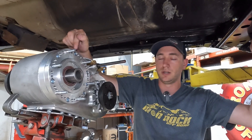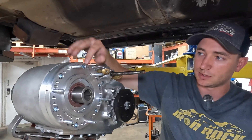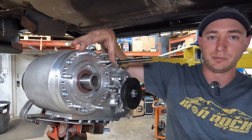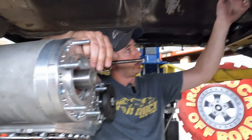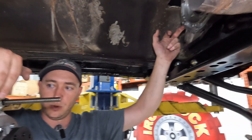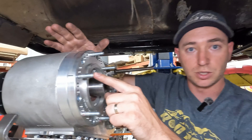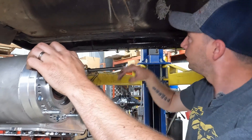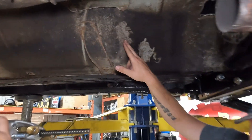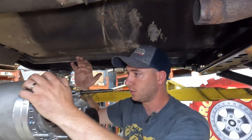We can now install, drop our doubler arms, and get them attached to make sure we have the clearance we need for the new boot. This is the AW4 XJ automatic adapter plate from Advanced Adapters for the Atlas. These are clocked one way, so you rotate it until all your mounting holes line up. We dry fit it with no studs, got it splined in, had a couple marks on the transfer case so we knew when the holes were lined up. We found the closest hole to get it as flat as possible, made a couple adjustments with the BFH for floor clearance.